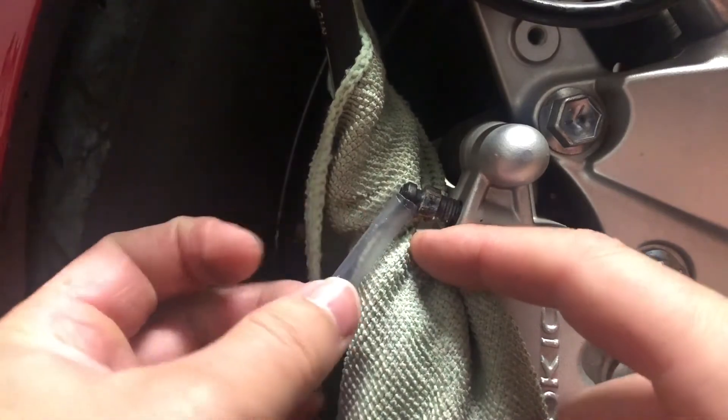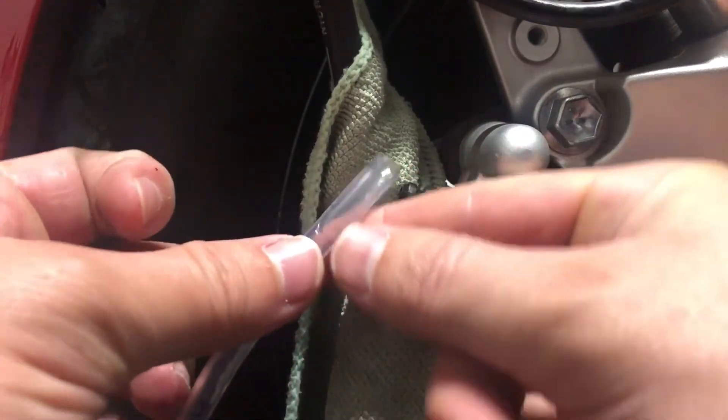Once the air came in, there's nothing left in the hose. And there you have it guys — we have successfully changed the oil in this front brake on my Suzuki Intruder M800. The procedure is very easy and simple. I recommend doing it every two years or so, just to keep your oil clean and fresh. If you found any value in this video, please hit that like button to spread it to more people. Thank you guys, and I'll see you in the next one.